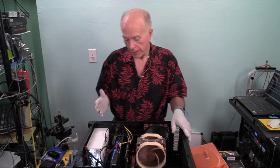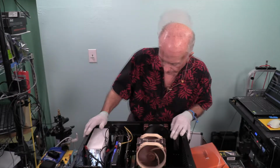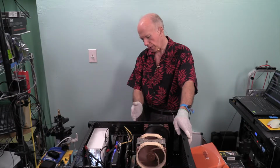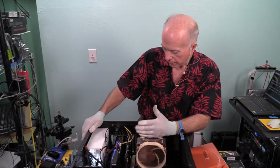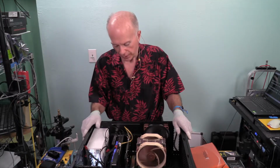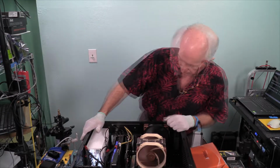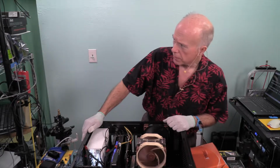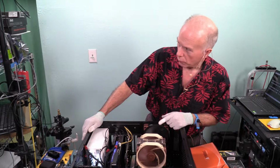And I don't need to go into the BIOS, so the first thing I may do is show you these lights right quick so you can see what I've been talking about. Fascinating sight. As we look at the I/O panel on the back, there's a red light that shows through from the I/O panel showing that there's activity, that there's power to the card. But anyway, nothing about drive activity, which I kind of thought we might see, which is what we get on the Supermicro Dual M.2 NVMe adapter. But I don't remember seeing anything about a definition on what those LEDs do. Now I see one. Fascinating. I see a red LED, so this may be something to do with going 2 by 8. I saw 5 green LEDs and 1 red LED.